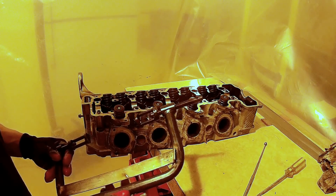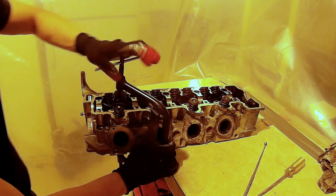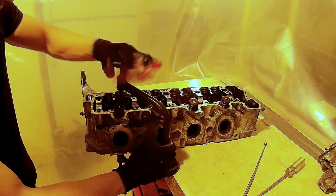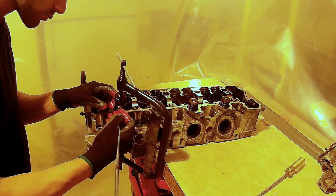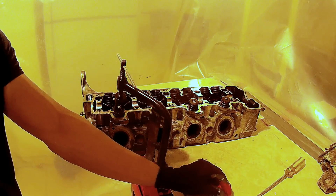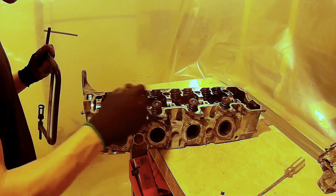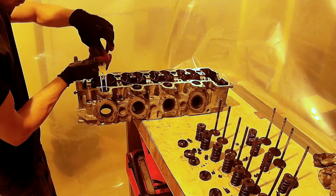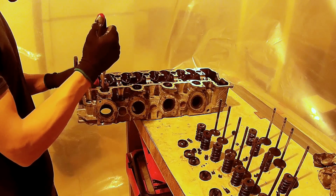After everything was done with the hydraulic lifters, next I got to removing the valve springs and the valves themselves. For this I was using a valve spring compressor I bought off Amazon, but it was so cheap that it bent before I even used it — that's why I had to weld an extra metal support on it, and after welding that it actually worked. You just compress the spring by turning the screw, then use a magnet to remove the clip that holds the valve in place. Once the clip is removed you uncompress the spring, the spring comes off from the top, and the valve falls out from the bottom.